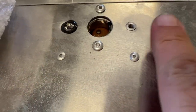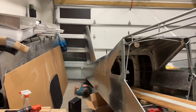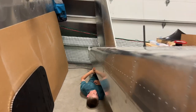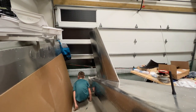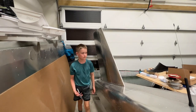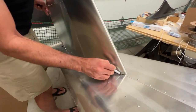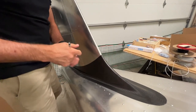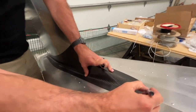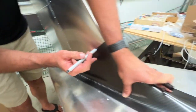This one's cleaned off; I need to clean the JB Weld off the other one. They went pretty well. Thanks to this young man's help, we've now temporarily installed the vertical stabilizer. We're temporarily installing it so I can trace where it lines up, then put the carbon fiber fairing on and trace its outline to pick mounting locations. Then I'll match drill and squeeze in rivet nuts for final installation.